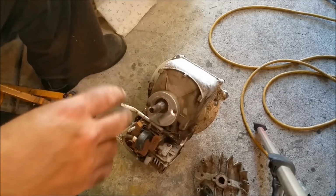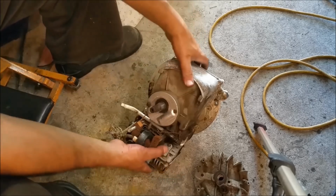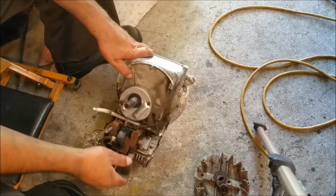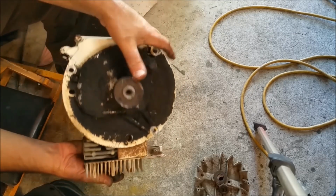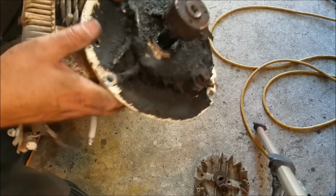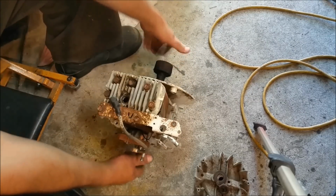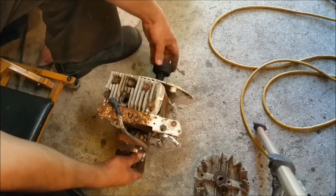Right, and 99% Briggs. I was worried the crank might be bent. If it's not, it probably is now. I'm carrying it at sort of this height by the fan. Of course, I didn't tighten that properly and she fell off and landed on her bottom right there. So if the crank wasn't bent then, probably is now. So let me just rotate. You can see actually a bit of oil since it's been turned around. So that bottom seal is going to be cactus. We don't care about that. That's good actually. That seems fairly true.